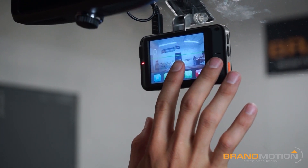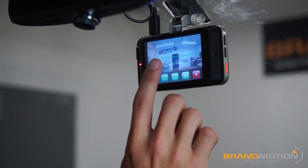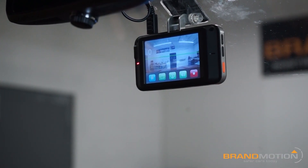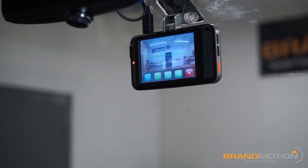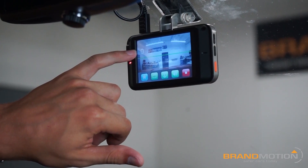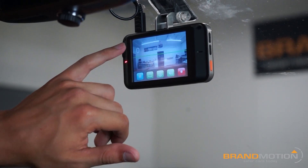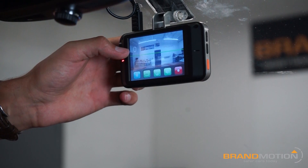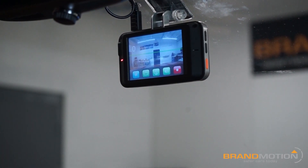You'll see that the green line is there with no cross in the middle. Now what we're going to do — and you'll see this in the next clip — is we're actually going to go drive it around and it's going to automatically calibrate. We're looking for straight roads with good lane lines. When it starts the calibration process, you're going to see a red cross in the middle of that screen, and it's going to stay there until the calibration process is over. Then that arrow is going to turn blue and it's going to give you a little audible tone. Before we go out for a drive, I'm actually going to connect my GPS antenna. As you can see, we have a little zero telling me I'm not moving. We want to make sure that is white. The only reason I didn't do it sooner is I wanted to make sure the harness had enough room. That's actually where you're going to get your speed data. So if you start driving and it's not white and not giving you a correct readout, something wonky is going on — just give us a call.